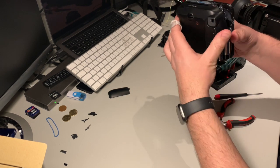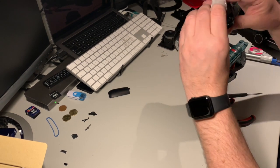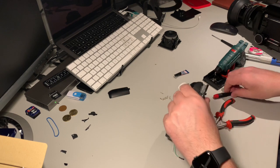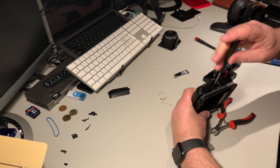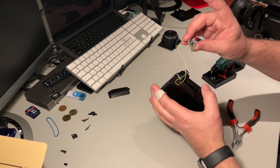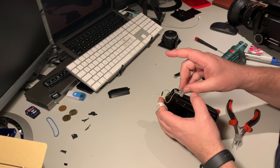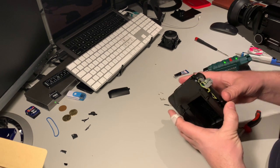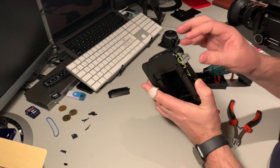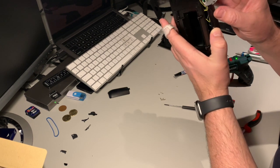We're going to put these guys back together. Now is when your screws from before come back, and I just close it all up. For the last part, we're going to glue this on — just about here — to make it easy to eject. I have just applied the hot glue here, and it rests nicely in this little slot. I'm going to glue it in here and then stuff the wires inside, so if at a later moment I want to open it, the wires are long enough to actually open the back.